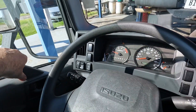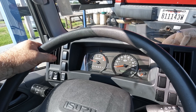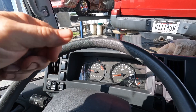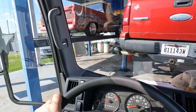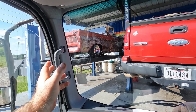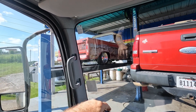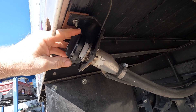I gotta grab my scanner and clear the check engine light. I noticed the gas cap doesn't fit right — maybe we'll wait and tell them to get a better gas cap. The filler neck could be damaged — the cap will go in about a turn and then stop like it's the wrong thread or the filler neck is damaged. Got the undercoating and Ospho sprayed underneath to get rid of surface rust on the frame and the bed supports. There'll be a separate video on that. The gas cap no matter how hard you try will not thread in straight — something's wrong.